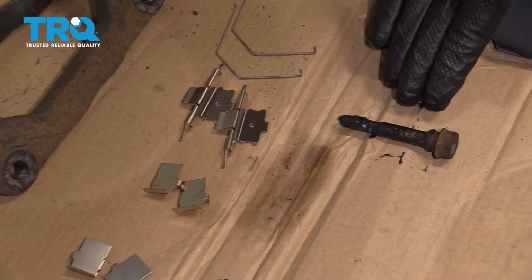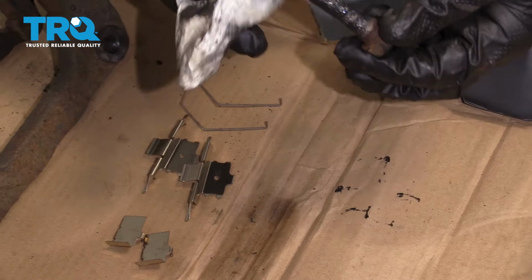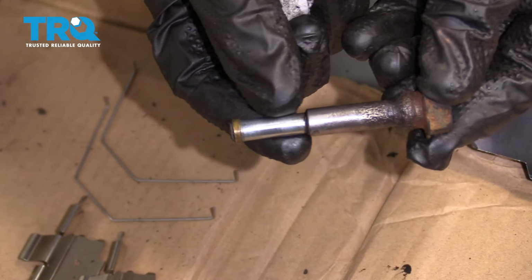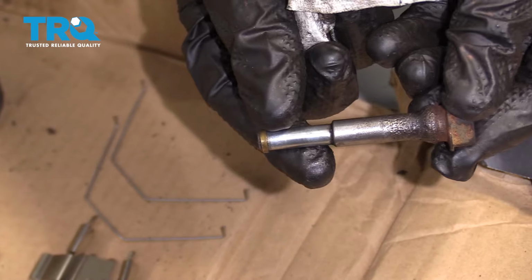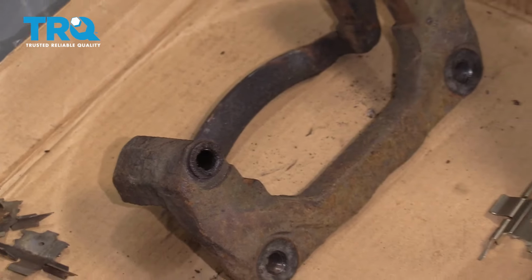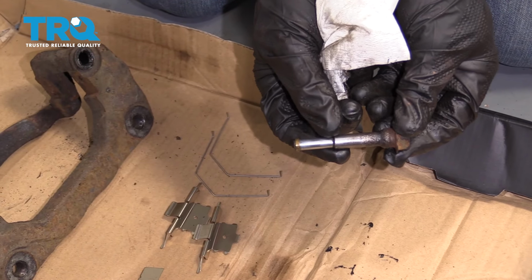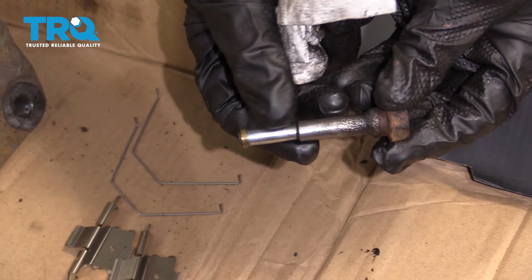Speaking of the sliders, you want to make sure that you keep these on their corresponding sides. Once you clean these off, you're going to notice that they're different. Now this one right here, you can tell has this cutout area right there. That's actually where there's supposed to be a rubber boot. It's a vibration dampener. If you were to try to put this into the wrong hole, it's not necessarily going to work properly. Ours is missing, and to be honest with you, we're going to be replacing the caliper in the next video, so I'm not really necessarily worried about it.